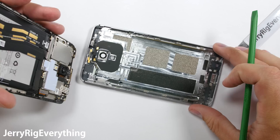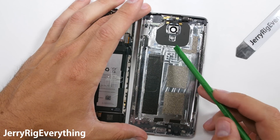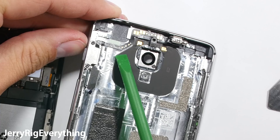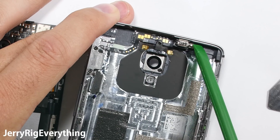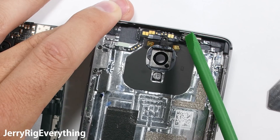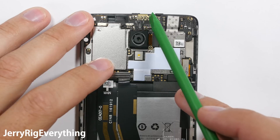The screen lifted out relatively easily once it was up. And here is the single slab of aluminum that OnePlus talked about. You can see the mill lines on the bottom, so they weren't joking around when they said it was a solid block of aluminum. The alert slider has little contact points at the top that also connect to the vibration motor. I will show you the contact points on the motherboard — this is how those get their signal from the phone itself.